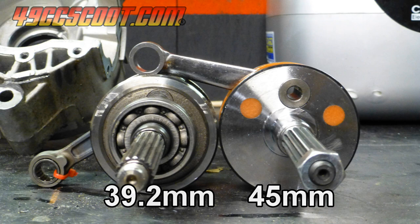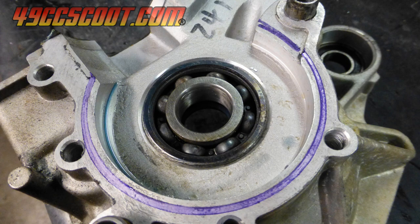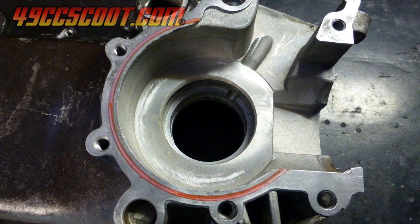Some of the smaller stroker kits, like 41.4 or 42mm, may be able to fit, but usually the longer strokes won't. Most of my stroker cranks are more than 78mm in diameter and not even close to fitting in a 49cc case. The exact sizes of cranks and cases will vary from one engine to the next to some degree, but expect to need the cases cut for more clearance if you plan on building something with a longer stroke, especially if the stroke is 42mm or greater.